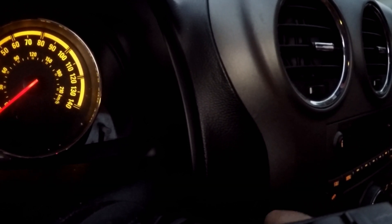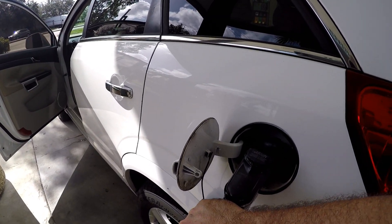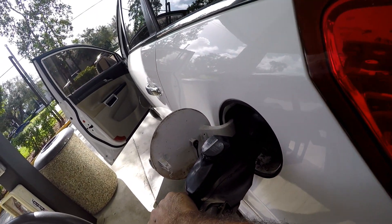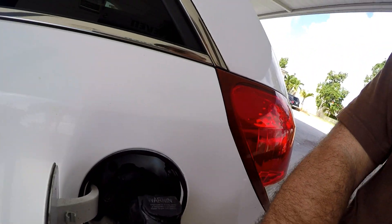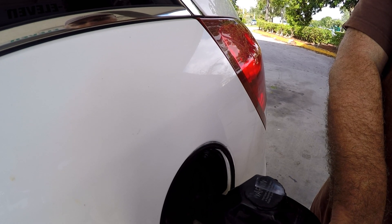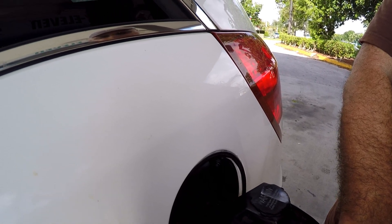The final test is fueling up and see if it starts up right away. I read in one of the websites that overfilling your tank will eventually damage the purge valve — I'll put the information in the description. I also had some links to the parts and OBD scanners I used to get the code. So when the fuel nozzle automatically shuts off, don't try to cram more in there.